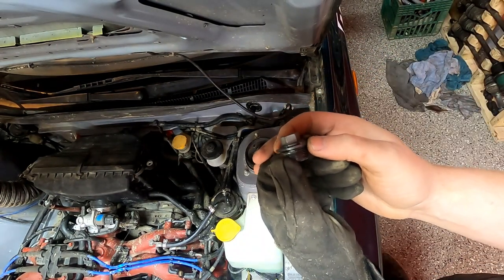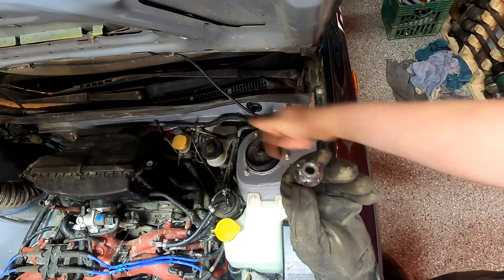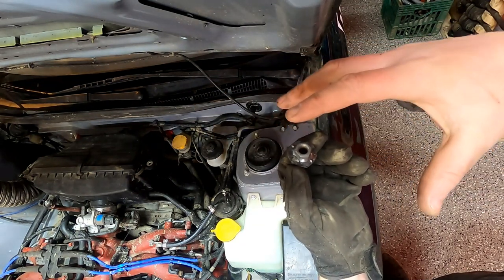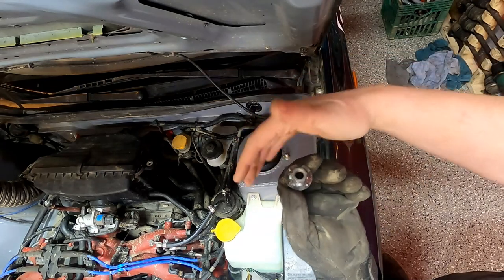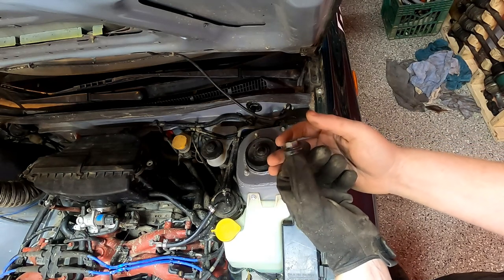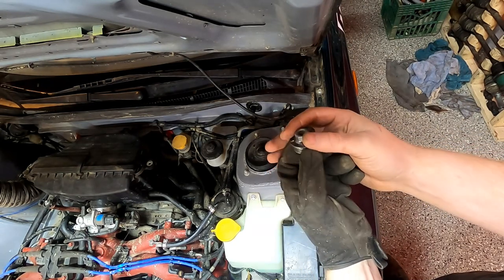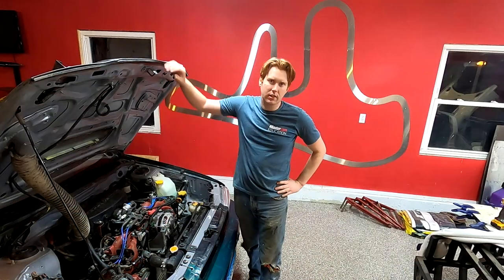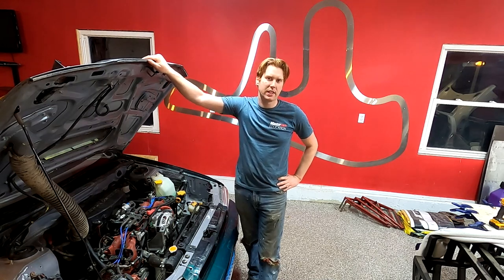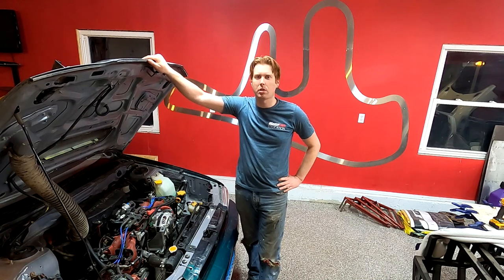So now I've got the nut all welded onto the plug, and this is the same size as all of the bell housing bolts on this engine. So if I ever have an issue and I've got to yank the engine, I can go right from the bell housing to the clutch fork pin cover here and not have any special tools required — it makes it that much easier to get the drivetrain in and out. That's it for this video. I hope you found some helpful tidbits. If you have any questions leave them in the comments below, and I'll see you on the next video where we talk about interior prep.